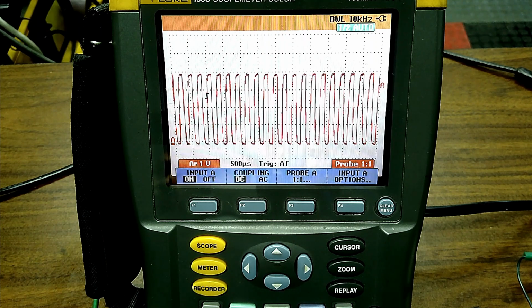Great job. Because as you're adding more grams of air, that is a command for more fuel. So fuel trim numbers should change. And obviously the O2 signal should stay more to the rich side. Very good, gentlemen. Very good.